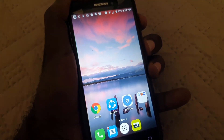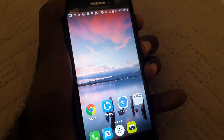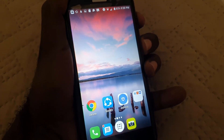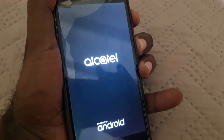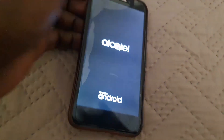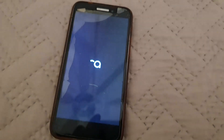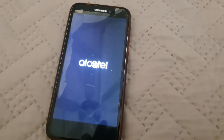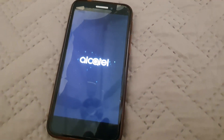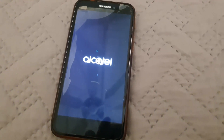I'm going to hold both at once. A screenshot may be taken — that's normal. Keep holding power and volume down. In some cases you can hold power only for about 10 to 15 seconds, but the best way is power and volume down. Once you see the Alcatel logo, let go — and that's all there is to a force restart.